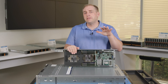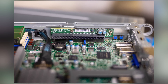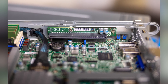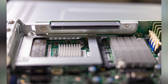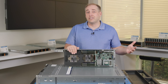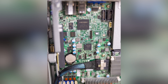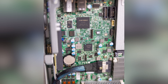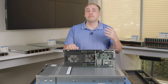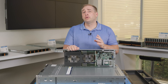Moving behind the CPUs, we get two low-profile PCIe Gen 4 x16 slots. PCIe Gen 4 is a new feature from the Ice Lake Xeon processors, and practically that means we can drive four 100-gigabit-per-second ports without oversubscribing PCIe bandwidth — something that wasn't possible in the previous generation. We also have an ASPEED AST2600 BMC — a new generation of baseboard management controller — which is a bit faster and comes with a new management interface on these X12-generation boards.